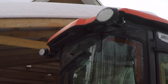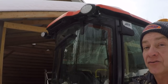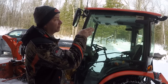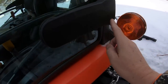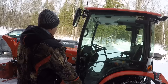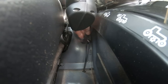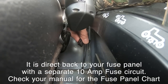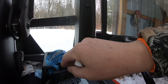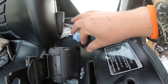Many cab models don't come with rear work lights standard, but the bracket will be there and the harness will be sticking out from underneath the cab, so you've got a great place to connect. If you do have rear work lights though, I know you should not be traveling the road with big bright work lights shining back at the drivers behind you — that's another reason I put it on the front. If you plan on mounting it on the roof and taking the roof off your cab to run your wire down through your corner post underneath the fender, following the wires already routed underneath and up into your cab to your dashboard and fuse panel — if you have a B2650 or an LX model tractor, Kubota has left a 12-volt power supply on a mini 2-pin connector hanging right in the back behind the seat. So it may be viable to bring your wires down that side post, in underneath the side fender, and use that as your power supply. You've also got a little bit of space on the side fender to drill holes for switches should you choose to do that.